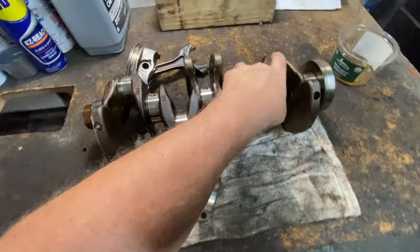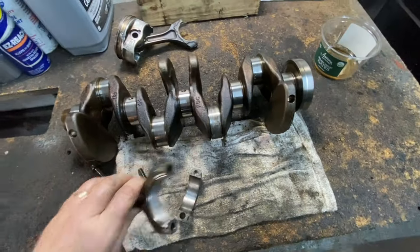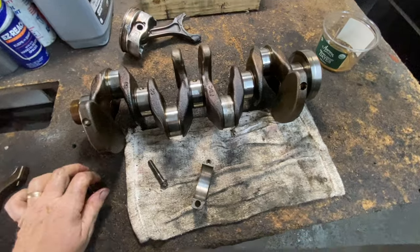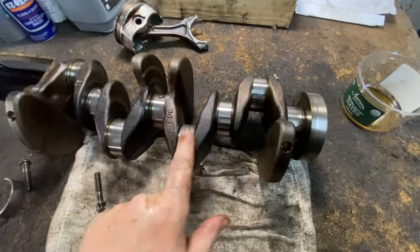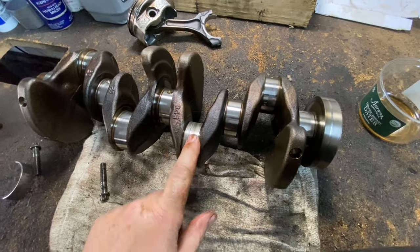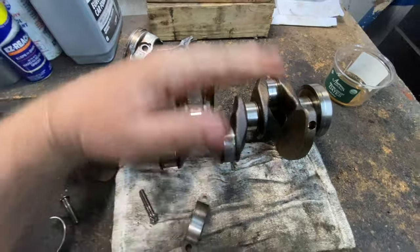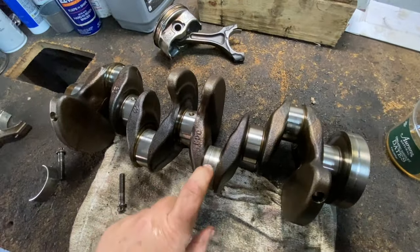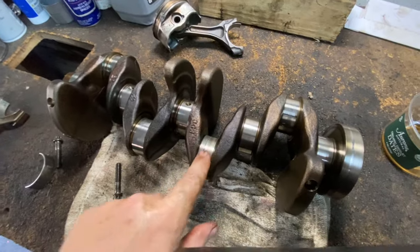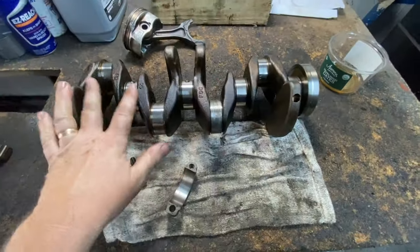Okay, so what do you do if you do have a rod knock, right? Mechanic says it's a rod knock, 100% it's a rod knock. Well, usually it's the rod that seizes. Well, if it was a main bearing, it's not going to knock because the whole crankshaft spins, it's not going to knock, it's just going to seize. But usually, when it's an engine rod knock, it's going to be the bearing. So, obviously, on this thing...